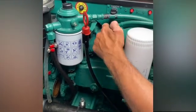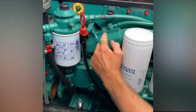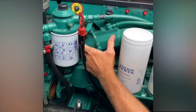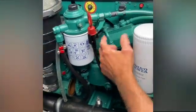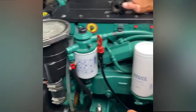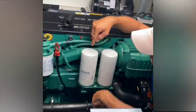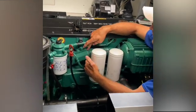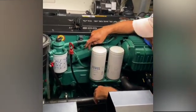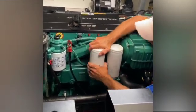What we're going to have to do is remove the holding bolt and eventually remove the water hose to pop off that area and get to it. We'll slowly go through the process. First, we're going to have to remove this oil filter because we won't be able to get to one of the hose clamps to access that part, then we'll go from there.